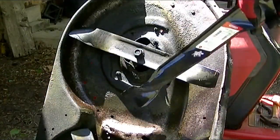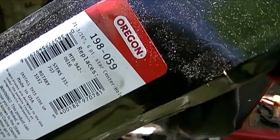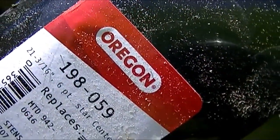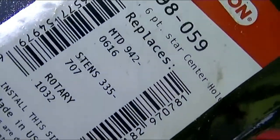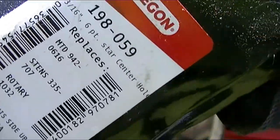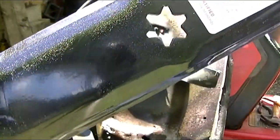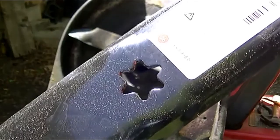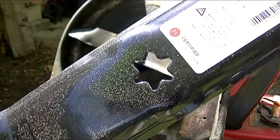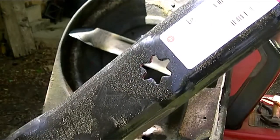Okay, well, here's the other side. There's the first blade that we're going to remove, and these are the blades that I'm going to be putting on there. As you can see, there's a part number 198059 by the Oregon company. I'll put more information in the description if needed. So this is the blade that I need on this 2007 Husky LT4200. You see the star in it? That's the star center. There are other blades that are different than the star, but make sure it fits on yours first, okay?